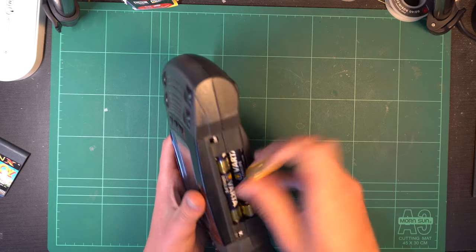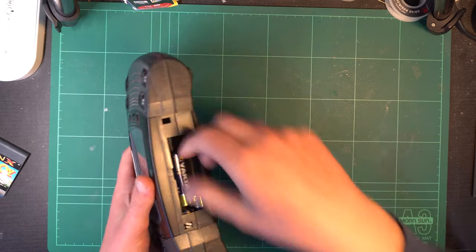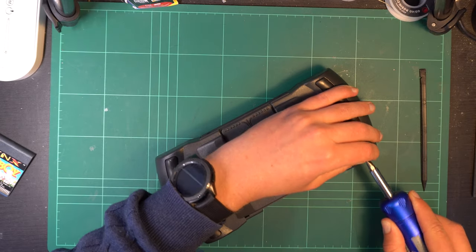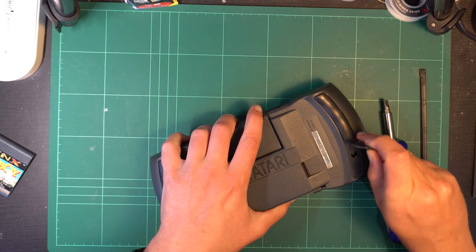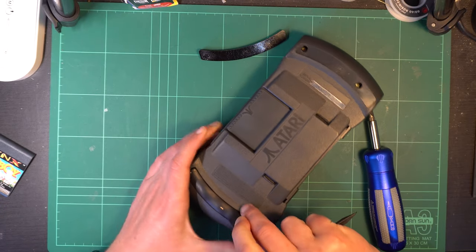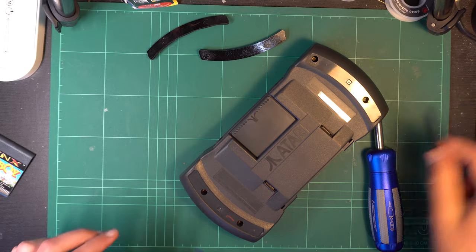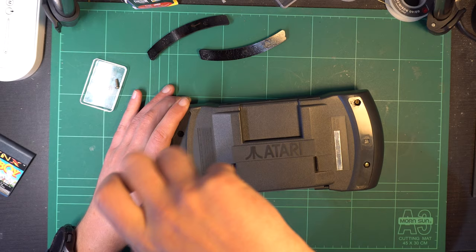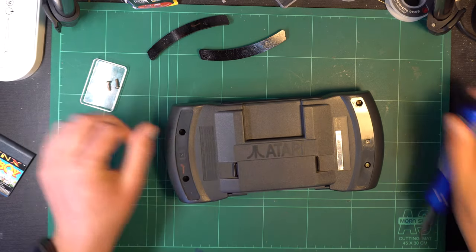If you've been watching my previous Lynx videos, you're probably well educated on how to do this by now. But if you're not, you want to start by removing the batteries. On the surface, it doesn't really look like there's any screws at all — that's because they're hiding under these bumper pads. You'll want to pry these off with a flat headed screwdriver, just keep them facing up as we'll want to re-stick these when we've repaired the Lynx. The four screws are just your standard Philips head, so you won't need any special screwdriver like when you're repairing Sega or Nintendo products.